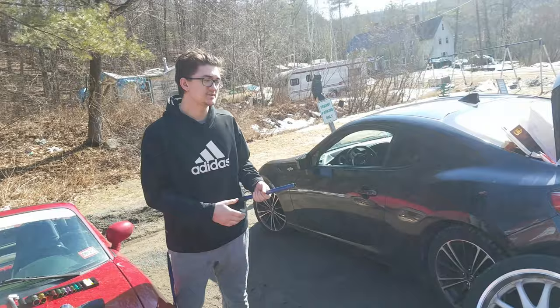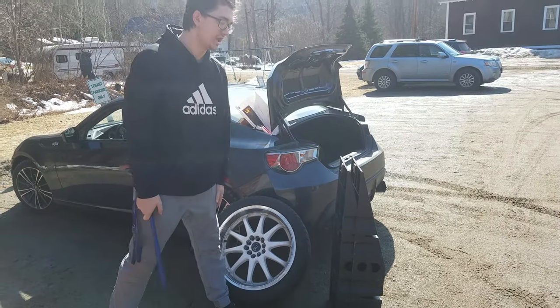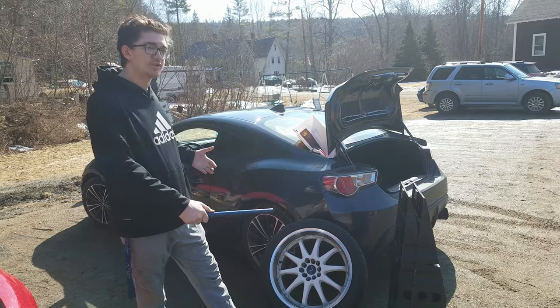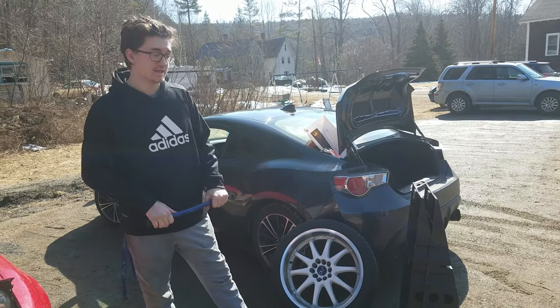And another thing that we're also going to use, I like them for low cars, is the Rhino ramps, race ramps, whatever you want to call them. They're extra handy for getting the car jacked up nicely, because you pull the front up on them, jack it up, throw an axle stand underneath there and call it good, and then you're pretty well set.